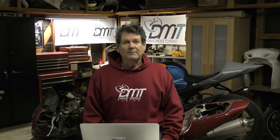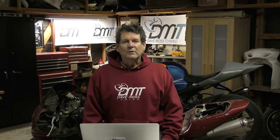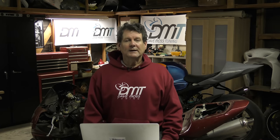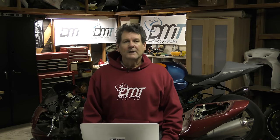It just looked like a clapped out race bike, club race bike. I mean, the rebound adjusters on the forks were so smashed, I'd take a Dremel tool in there, widen up the gap so I could get a screwdriver blade in and do the adjusting. And it just had a stock crappy shock. And then Moss got me a cool Elka shock and we upgraded it. Fantastic bike. Oh my gosh.